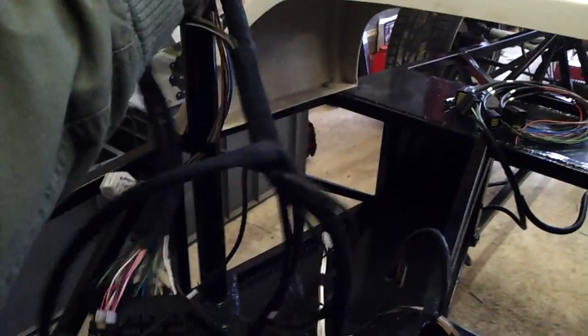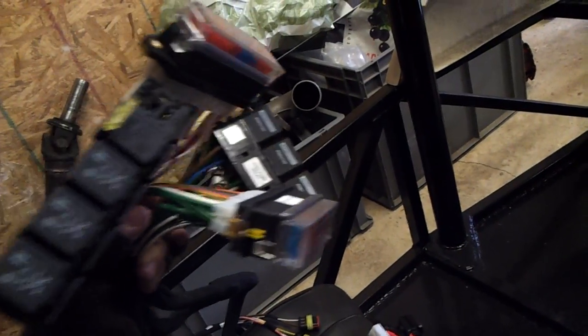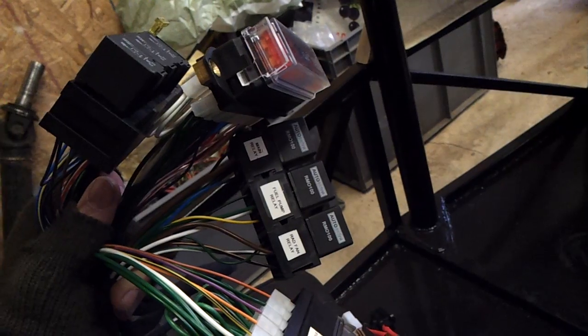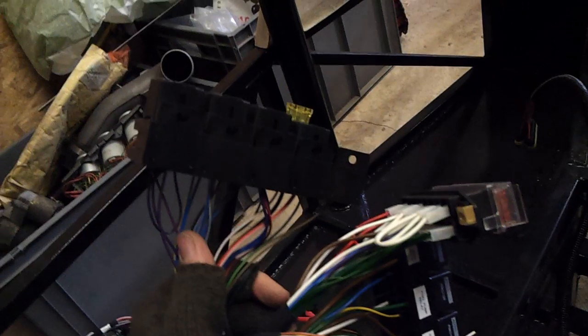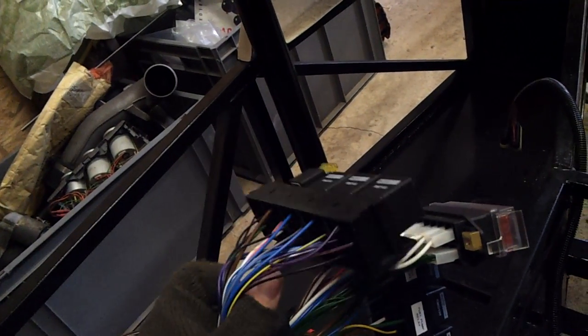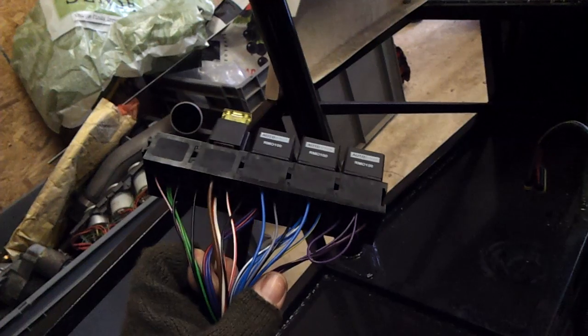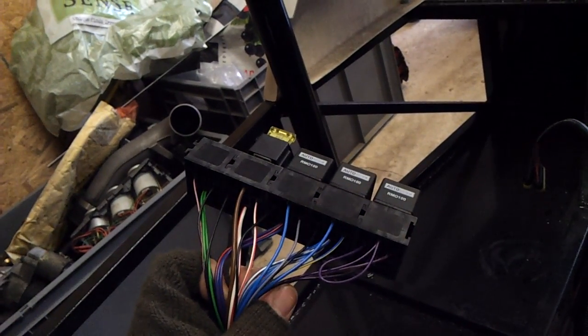This whole section here includes all the fuse boxes and relays. I've got two sets of fuse boxes and two sets of relays. One is ECU — so that there is the ECU relay, which covers the fuel pump and everything, all in one. And this is the main car relay, which covers all the wipers, indicators, everything really. I'm not having wipers, so I don't really need that, but it's nice to have it installed just in case I decide to add a windscreen in the future.